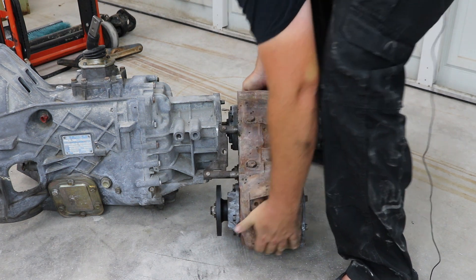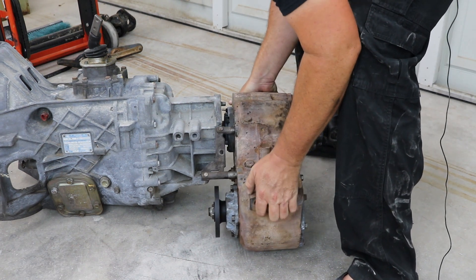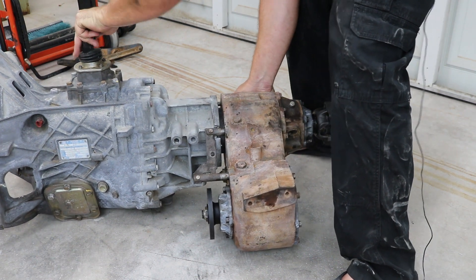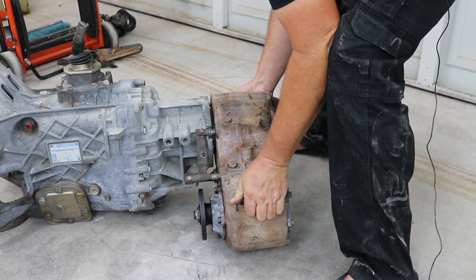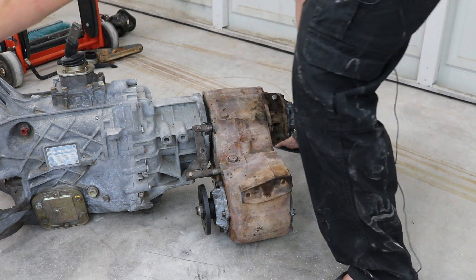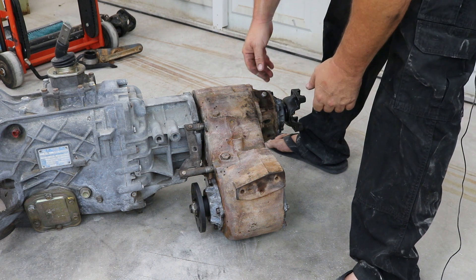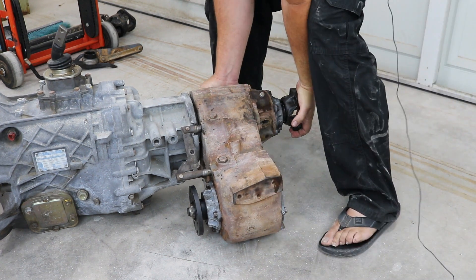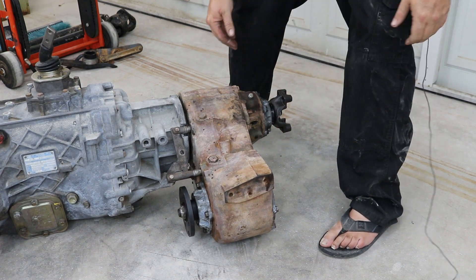I rotate it down — it has got to slide in on the splines first, and I probably should have put a little bit of grease in there to keep it from corroding and to make it slide on better. It doesn't want to go in the last little bit, so I am going to get some bolts and pull it tight to make sure everything fits together like it should. It is much easier to do it on the ground than underneath the truck on a lift.